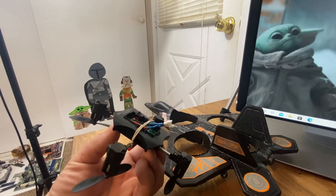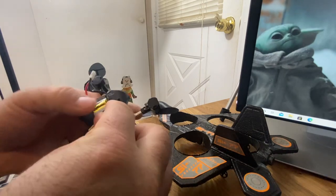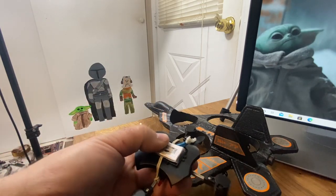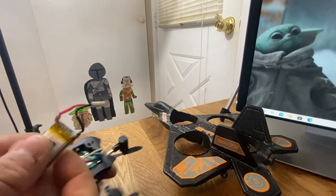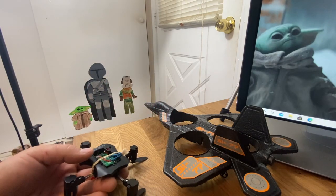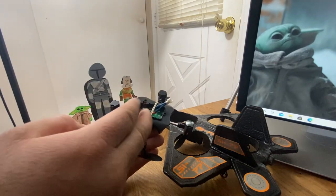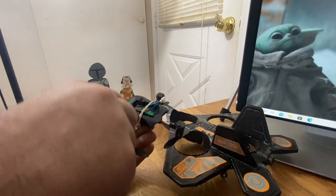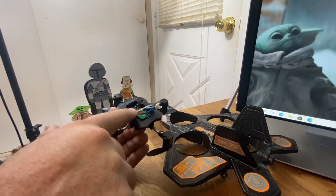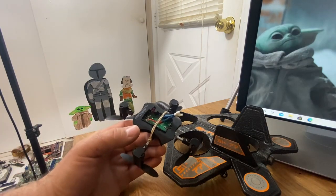The reason I stayed away from the Dremel is that the battery is literally snug right in there. If you go too deep with a Dremel you'll cut the battery. I wanted to keep the battery intact. So I cut little channel holes here and here, cut the channel, then cut the bigger piece, and kept trimming it down. You could still use a little file to clean it up.